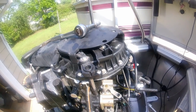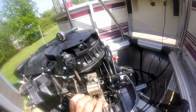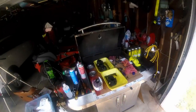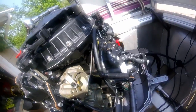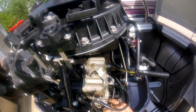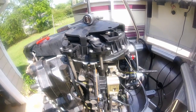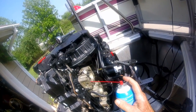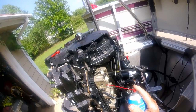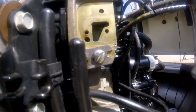I'm going to pop this off since it's away from the fuel line — the fuel rail — where I can get to it, and just see if it's clean in there. I'm hoping it is, because I don't want to have to take them back off. That is good — it is clean. I'm not even going to worry about the rest of them. When I squirted in that jet, anything that was in them holes was pretty well washed out through the vent, and I can see those open nice and clear.